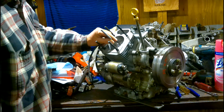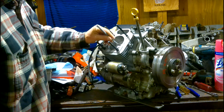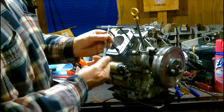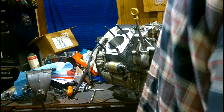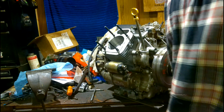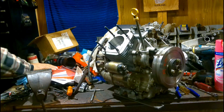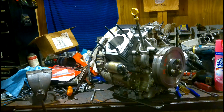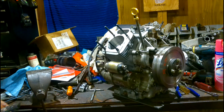Next step — we're going to have to gauge the pistons and find out if I got a bad piston from the factory. I'm leaning that way because the bore gauges don't lie — the bore is dead on. We're going to have to mic up some pistons and see what we got. We put new rings on it and still have the same issue pumping oil, so it's got to be a piston out of round or a factory defect.